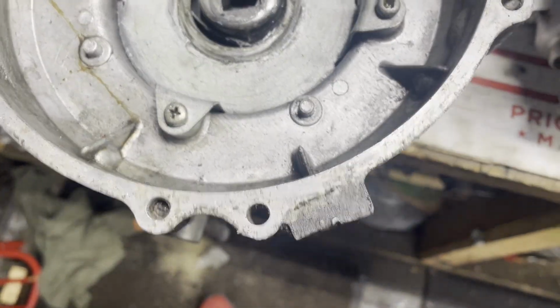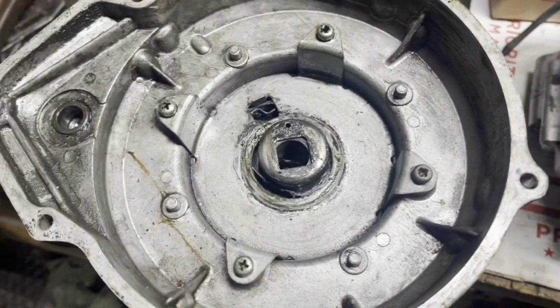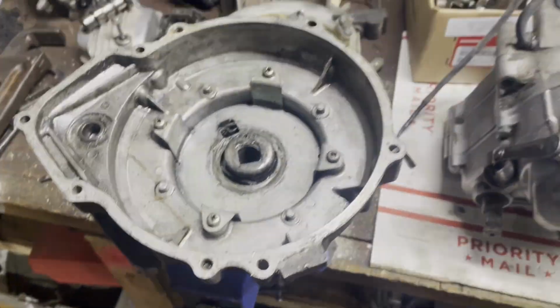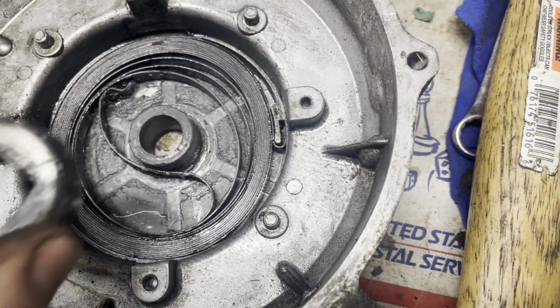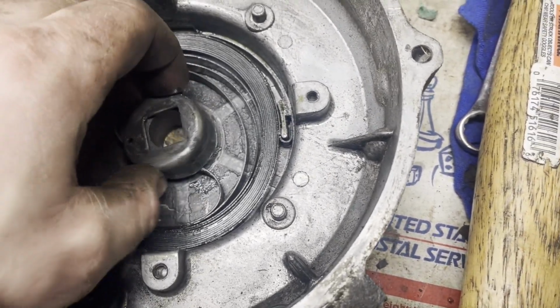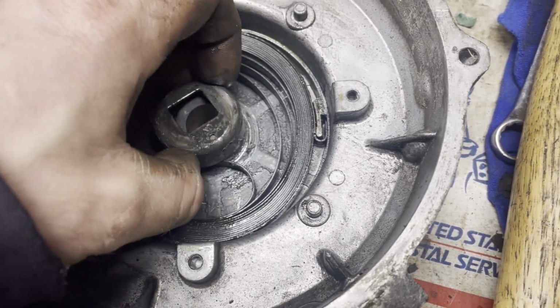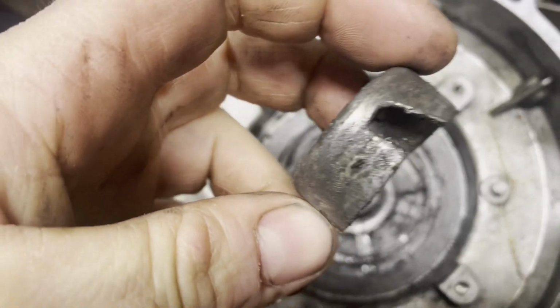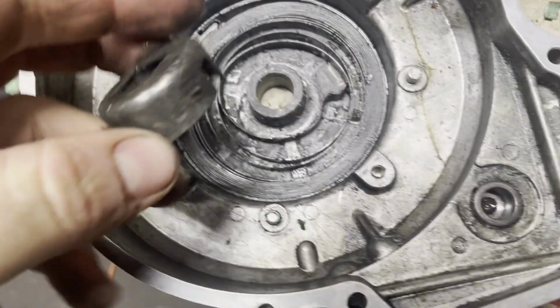This case, like I said, is probably broke. I'll have to bend it, rehook it, wind it back up, but then we should be good to go. Looks like the spring got all wonky in there, and it looks like this piece must be what coils up the spring, this inner piece here. Okay, so looking at it, this does look right. It's a hair bent on the inside, but this does look like it's correct.